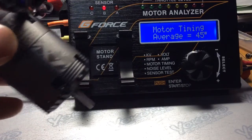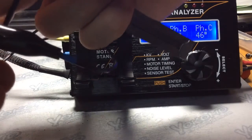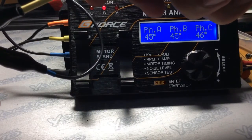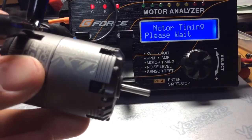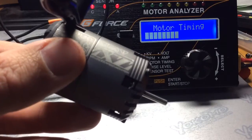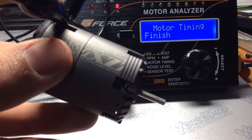Now I'm going to go to the past two-millimeter mark. Just give me a second — I'm going to use the digital calipers to make sure it's good. I'm going to make these timing rings easy to move. Two millimeters locked in, and I think that'll be as far as I go. It's approximately around the black marking here — so this is two millimeters past this hash mark here.